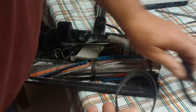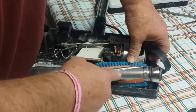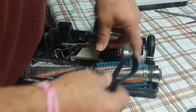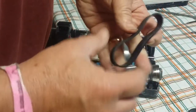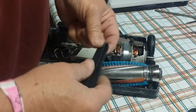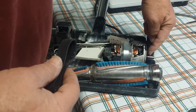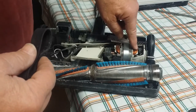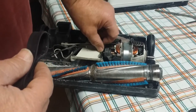Now what happens is when this thing is going around, there's so much pressure and friction put on these brushes by the carpet. When this belt stretches, there's not enough tension anymore to turn the bar. So the shaft coming out of the motor will start to spin inside the belt and can't spin anything. What happens is that spinning creates friction, friction makes heat, and that heat travels down the motor shaft into the motor and starts causing all kinds of problems — wiping out your bearings, melting the finish off the windings, causing winding shorts.